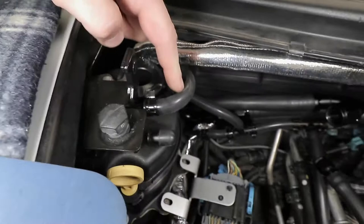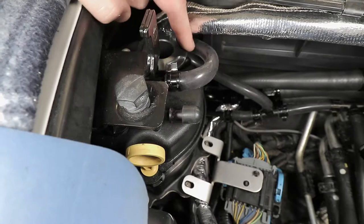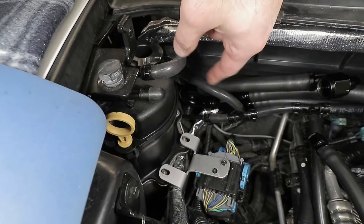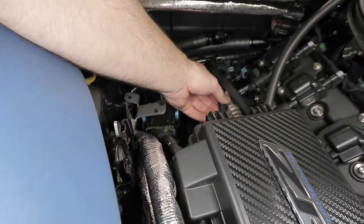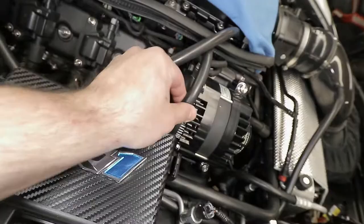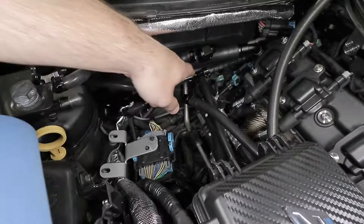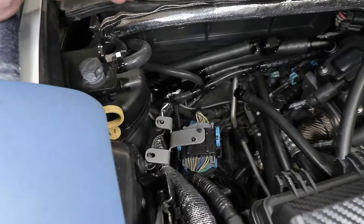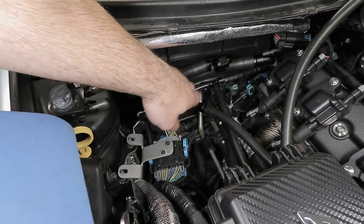When installing the CPR tank, you'll need to redo all the configuration. I had to cap off the original vent line and run a new vent line to the valve covers using silicone tubing bent down into a T-fitting. There's also a line that connects down low, then tees off to the front going to the valve cover barb. From there it branches off and goes to the other valve cover as well — basically replicating the stock routing but with clamps and silicone tubing.